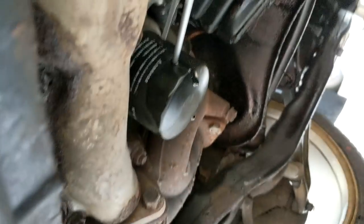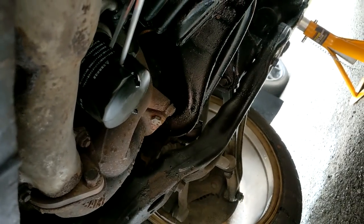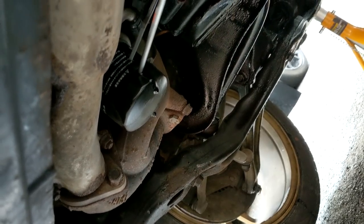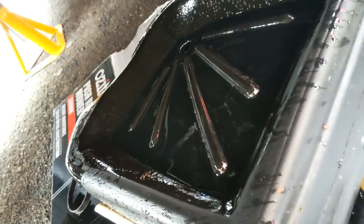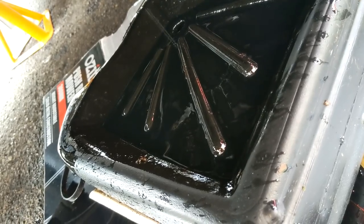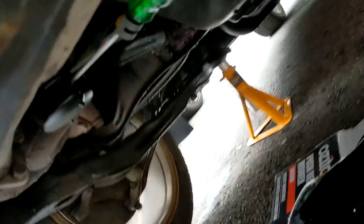One trick for getting an oil filter off if you didn't know is to hammer a screwdriver straight through it. I actually find this works better than any wrench - most wrenches are terrible for this. Going to get this off, drop the jack stands so it just drains a little bit more, then clean up this epic mess. This normally works on my Nissan but didn't drain quickly enough here - maybe it just releases more, bigger stream, but whatever.